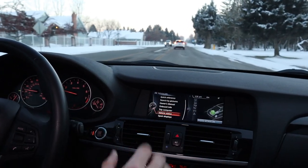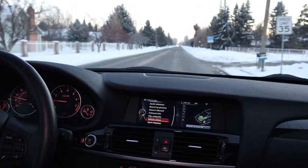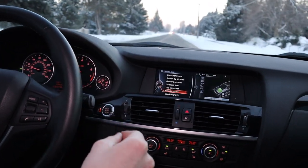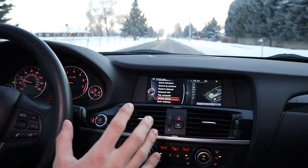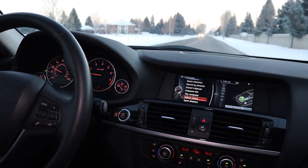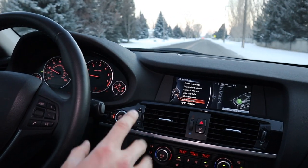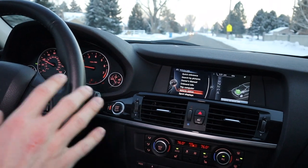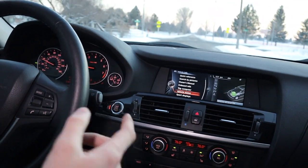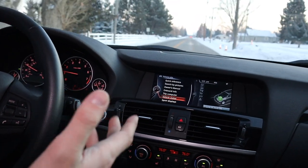We took it for a quick drive and as you can see, nothing else is showing up. It was pretty apparent when we were having problems before — it would throw that engine code and that transmission code almost instantly. The car would shake and splutter and wouldn't want to accelerate, the whole engine would sit there and shake. If you turned the car off and back on, it would run smooth, but once you put about a third throttle, that's when you'd see the issue come back. Everything's been cleared off. So we went through all the spark plugs and replaced one coil pack that was bad. If you're having any transmission errors like this, start with plugs and coil packs — that's the cheapest way to do it. If you take it to BMW, they're going to charge you a couple hundred bucks just to tell you something's wrong. Do these two items first — you're about 15 to 20 minutes to take the engine down enough to add the spark plugs and coil packs, and then another 15 to 20 minutes putting it back.